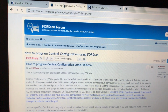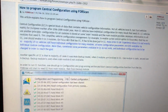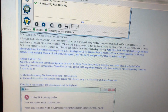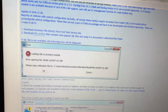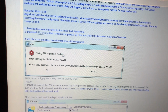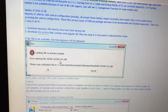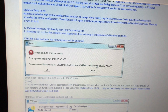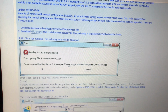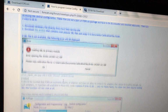Lastly, I'll put a link in the description. Tons of links here. But the FORScan Forum, this is where I found out some of the items. There's tons and tons of how-tos on how to do this. But specifically, this was the error that came up on mine whenever I was trying to do that secondary bootloader to open up the configuration, and it said cannot find this file. So I went in, I copy-pasted the one that you saw. This one's a little bit different. Downloaded it, and everything was fine. That's it in a nutshell.